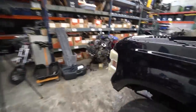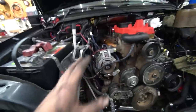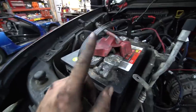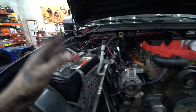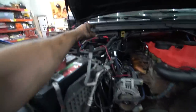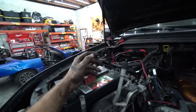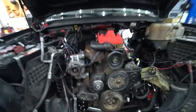Still the same result from inside, but more diagnostics. I went on a mission to pull the starter out — it's right by the frame rail and one bolt is really hard to get to, but we got it out and tested it on the floor. It worked fine. Put it back in, hooked just the positive cable to the battery with nothing else hooked up, jumper cable ground straight to the engine block, and it spun the engine over weakly but it did spin. When I tried with everything hooked up, it clicks and then I'm getting 12 volts back out of the trigger wire, which makes no sense. We're going to call it for tonight and pick it back up in the morning.